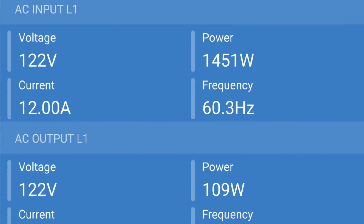That fixed the problem. I now have input voltage to both inverters. It was just that wire had come loose in that plug. It's weird because we've been sitting still for a long time - I guess it just got hot and then wasn't making a connection anymore. That would be my guess, but it's working now.